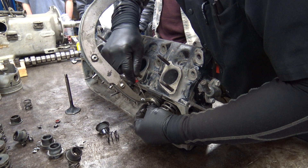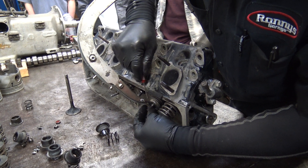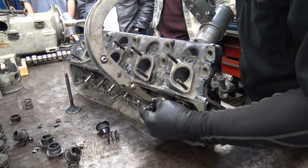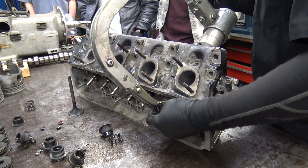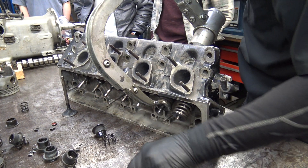So it was enough. He says, well, can I just drive it? I said, well, you can, but you better not run it out of coolant. It's going to get worse. He's rolling around with a cracked block. It's probably because it sat so long and it might have got hot one time.